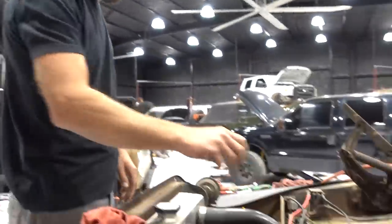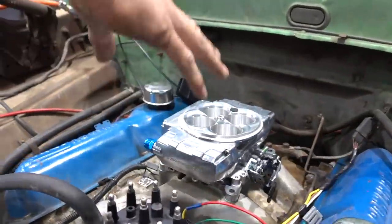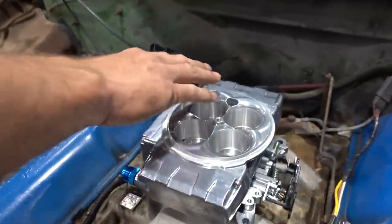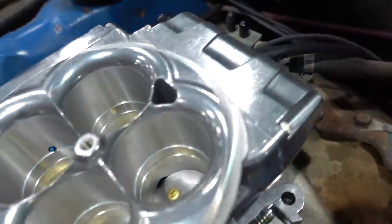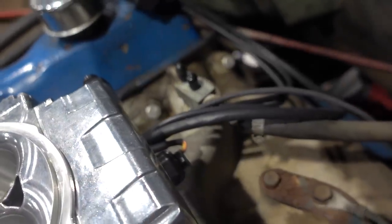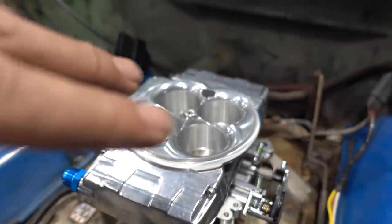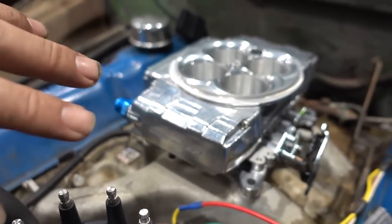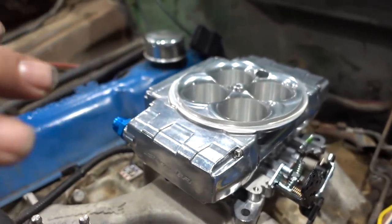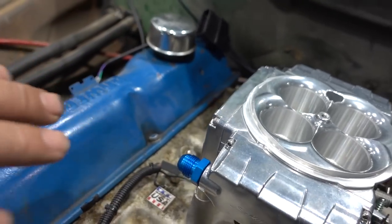But just to cover some of the basic things about this, you start by seeing the fact that all the wiring stuff comes out the backside. So when you install this, you don't have a bunch of stuff that's visually not appealing. So the harness comes out the back, which is excellent. It's still only 4 wiring connections needed to hook this thing up and rock and roll. It supports up to 650 naturally aspirated horsepower out of the box or 575 on boost. It's a new ECU that has improved RF noise interference resistance.